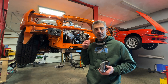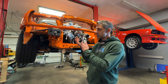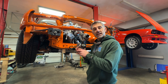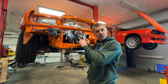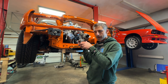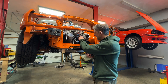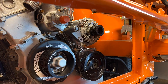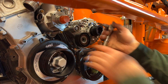In order to get the belts on, we've got to install our tensioners. This is our accessory belt tensioner — it is a hydraulic tensioner. We've got all of our hardware queued up and ready to just put on and torque. To tension it, all you do is take the six millimeter and tighten it, and it moves the hydraulic tensioner down and allows you to slip the belt on right over this bearing. We do need to put the coolant pump pulley on, so now we're doing a quick time lapse of installing this whole pulley tensioner system. We had to take the idler off to tighten them up and then put the pulley back on.